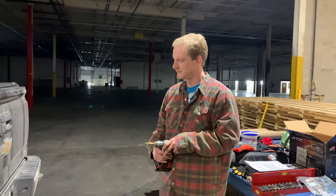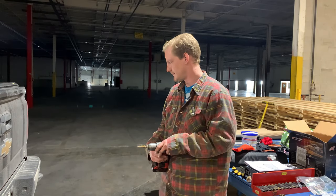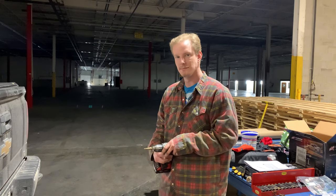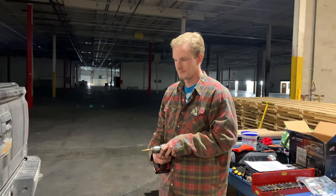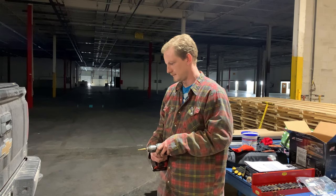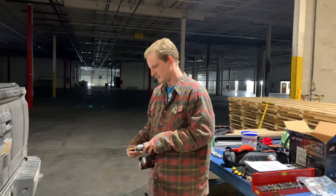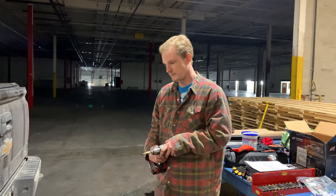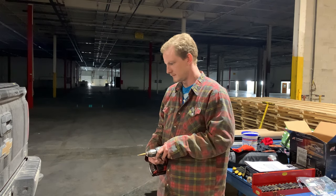So now that we've got the second airbag in, the next thing we have to do is plumb the air lines. And this isn't your father's plumbing work in the bathroom, because this is airline plumbing. We're going to go a little bit off script in terms of what they want you to do here. Normally, what the instruction manual tells you to do is to have two separate airlines, one for each bag.